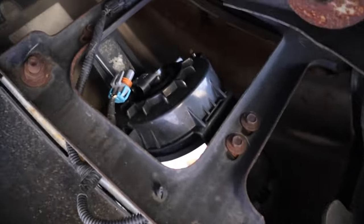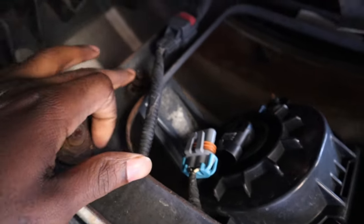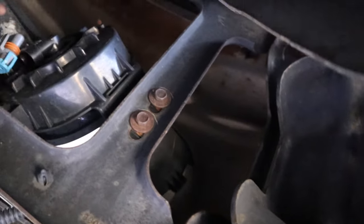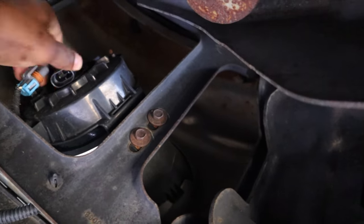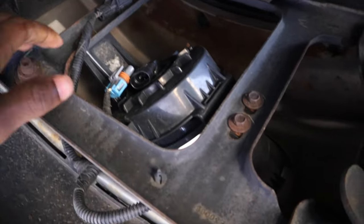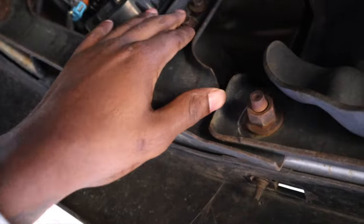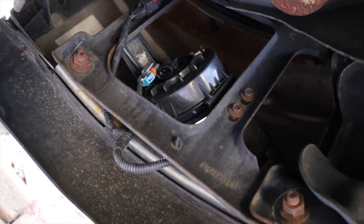Let's look under the truck. There are the original ones — there are three bolts to this. There's one right here and then two right here. Those are 10-millimeter size bolts. I don't need to unplug that right now — I'll take it out later. You unscrew those and the fog lights pop out. It's real simple, y'all can see what the bolts look like.